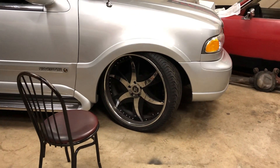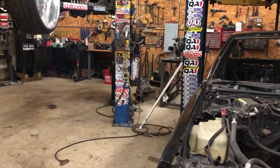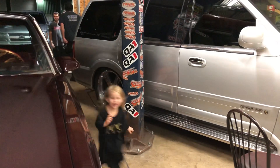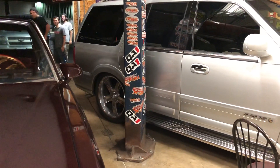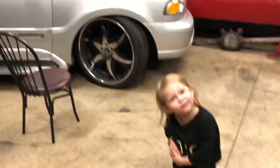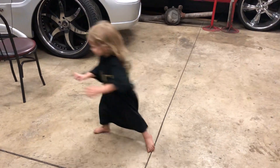So we're narrowing the rear end that I have sitting over there and realigning the rear end position and all that — making the tubular upper, tubular lower, and the panhard bar. Yes, look at Jello Joe.